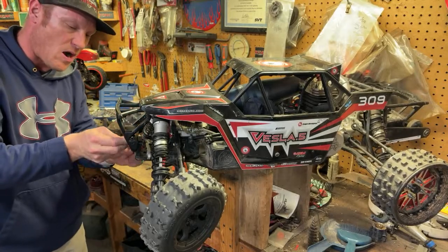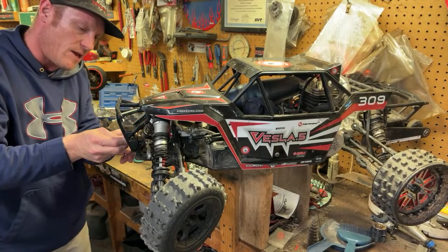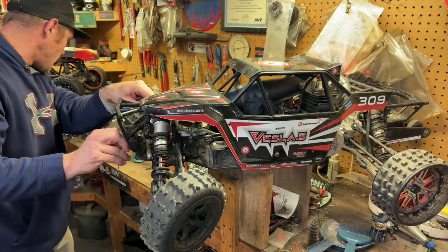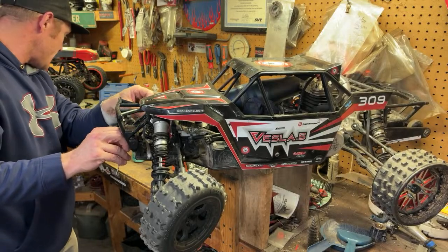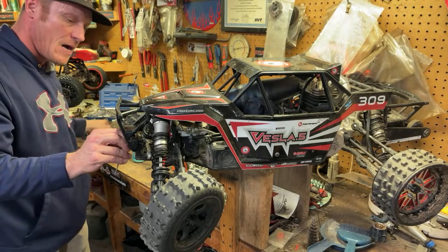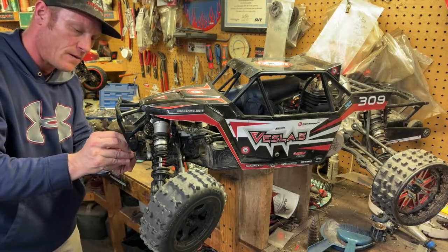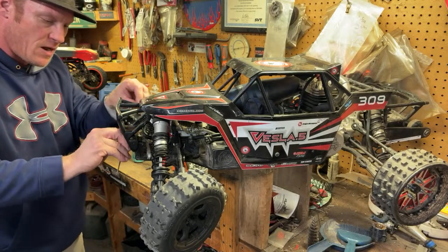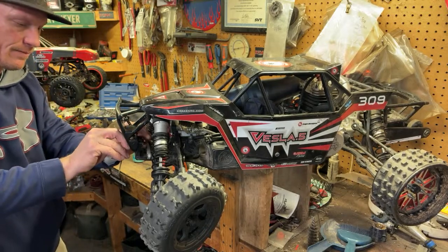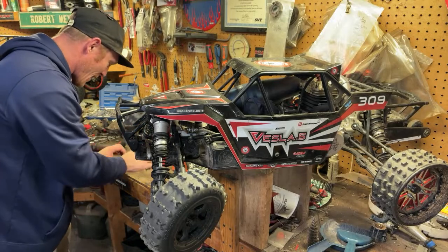And it's going to be a slow process because with these button head screws, you got to have an Allen key with a really good edge or a really good end on it. Basically what I'm trying to say is I've used this bit so many times it doesn't have the integrity my Allen bit has. It's kind of roundy on the edges and stuff. It's just been well used, one of my go-to tools. But when I try to use it, it just rounds things off. It doesn't work. So I gotta go a quarter turn at a time. That's why I want that quick disconnect.